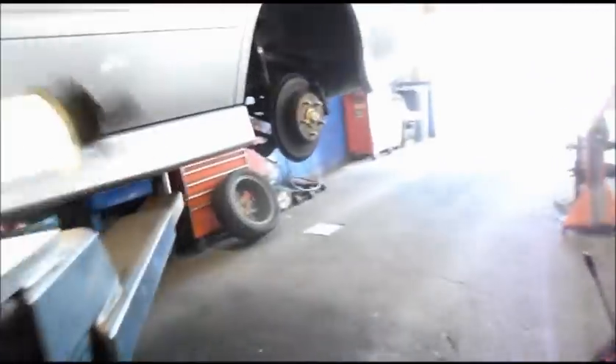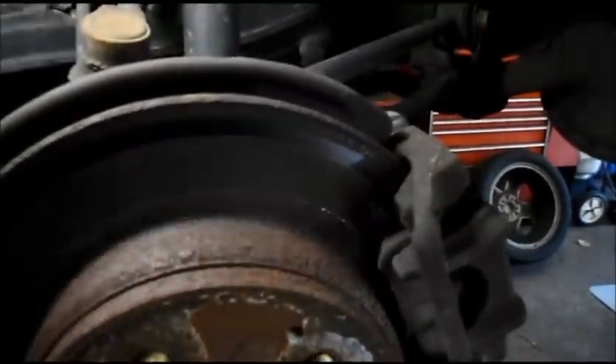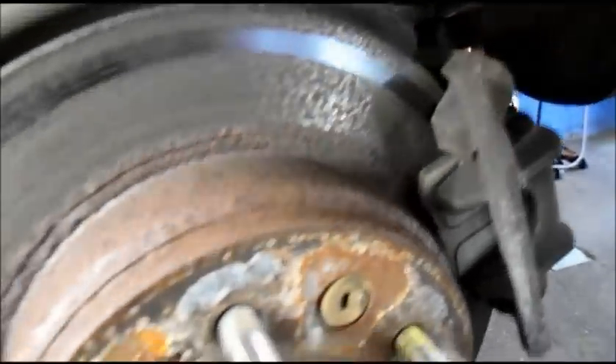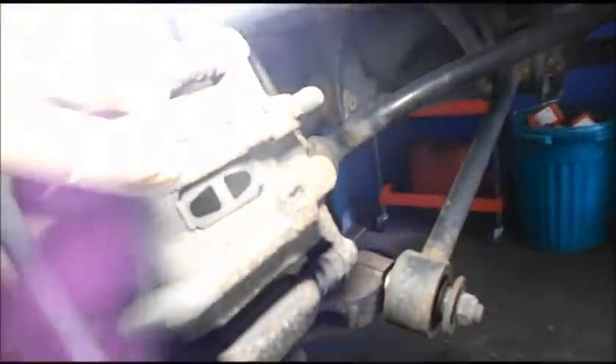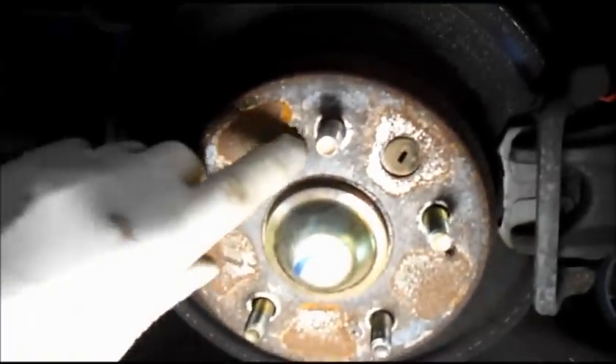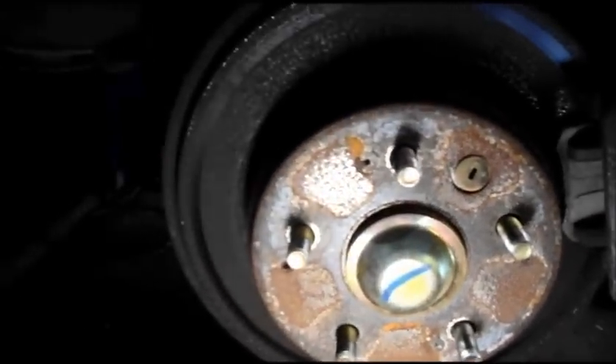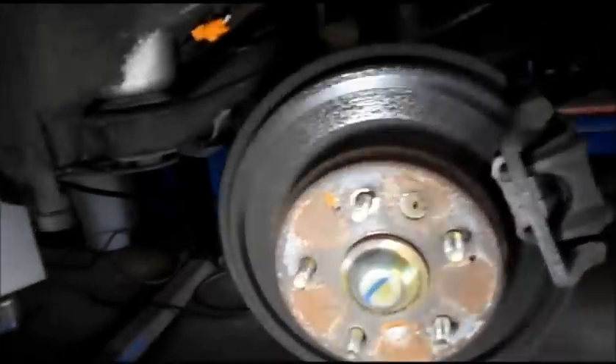Hopefully the slide pins will slide the way they're supposed to. I'll show you how to check that. I'm also going to show you how to get these Phillips head screws out because they can be a real pain — but I'll show you an easy way to remove them. Now the back is even worse than the front. When you spin this, you can hear the grinding coming out of here. We're going to do the same thing and change this rotor. The screws here are extremely rusty, but I'll show you what to do to get them out without breaking them.